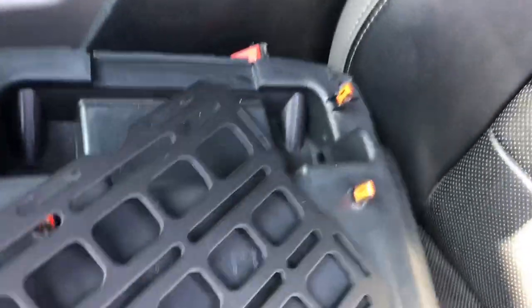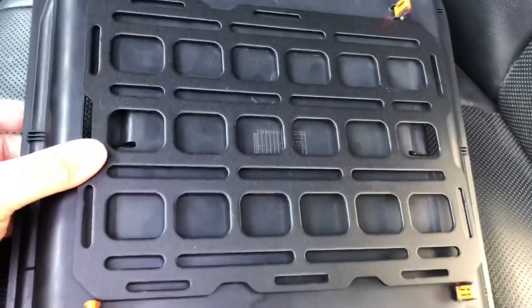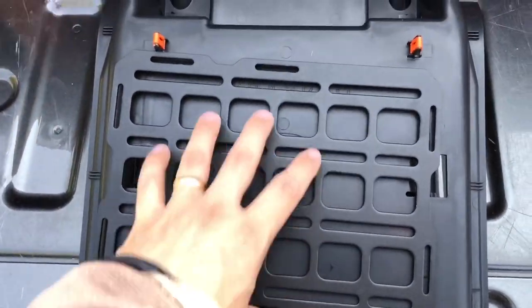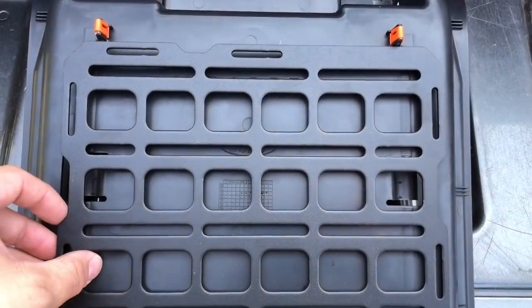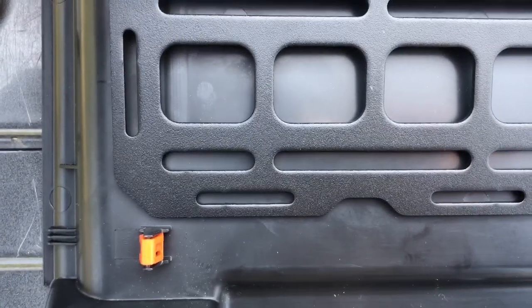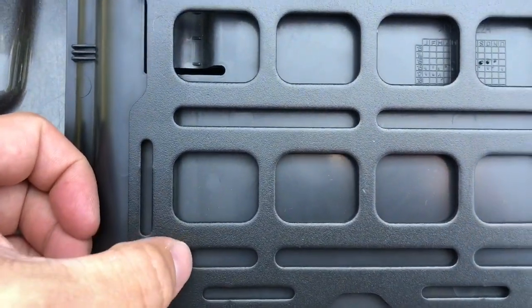So what I'm going to do is take our smallest Tech Plate here and basically mount it like that — mount it to this liner, though. I've figured out where it needs to go in between these clips. I'm going to use one of our hardware kits: drill some holes, use a spacer with the included machine screw and nut, and get it attached in there. Looking at the back side of the liner so I can see the clips — we obviously don't want to drill into one of these. I want this panel to sit about an eighth of an inch higher on the bottom than these clips, centered, with the bolts on the outside of this slot. I'm going to mark those holes and drill them now.